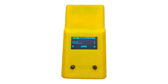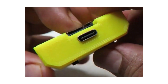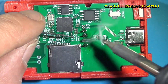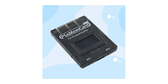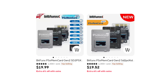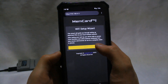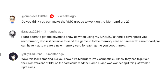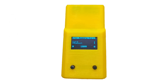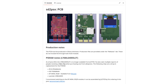And they're going up against the SD to PSX. For those who don't know, the SD to PSX is essentially just an open-source MemCard Pro 2. It has most of the same features, plus a USB interface that isn't obsolete. You can make your own SD to PSX if you've got the skills, but people also sell them on marketplaces like eBay and Etsy. There's also the MemCard Gen 2, which is just a mass-produced version of the SD to PSX — you can snag one of those for about 20 bucks on AliExpress. The one big drawback is a lack of wifi, so the MemCard Pros are your only option if you really want those networking features that I couldn't get working. Now the reason I have a MemCard Pro 2 instead of an SD to PSX is because you guys have been asking for months for me to add MemCard Pro 2 support to the XEB Plus Neutrino launcher, but also I didn't fully realize what the SD to PSX was at the time I made my purchase. It wasn't until I had the MemCard Pro 2 and began researching the MMCE protocol that I learned what the SD to PSX actually was and knew I had made a mistake.